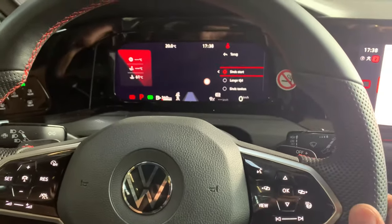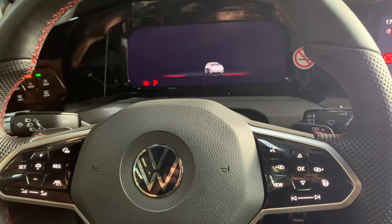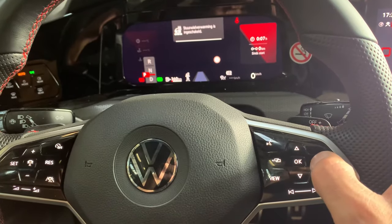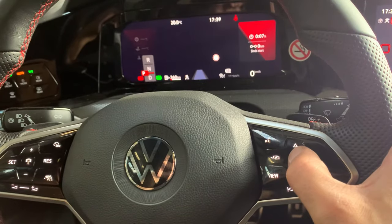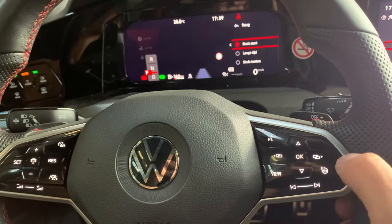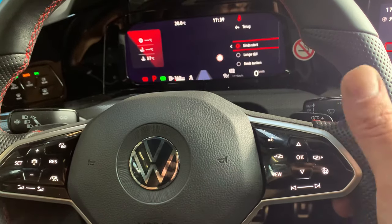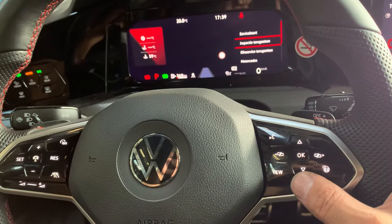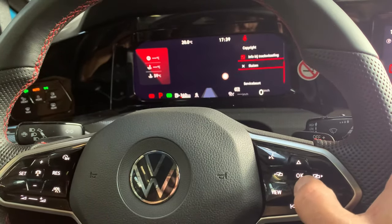One more time quickly to access the menu: the ignition is turned off, turn on the ignition, press the right button once, twice, three times — and the third time keep pressing it, four, five, then let go and the secret menu appears. This is for the oil change reset and this is for the inspection reset. You have other things you can watch here if you like, and to go back use the bottom button, then okay to close the menu again.